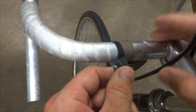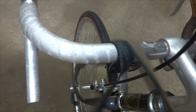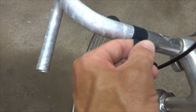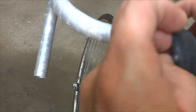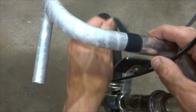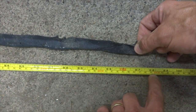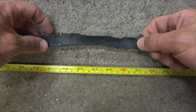I'm almost to the top of the bar now. Wrapping this around to see how they got started — it starts right back here, and it looks like they do about two centimeters worth of overlap before starting to spiral out. Now all the handlebar tape is off. Stretching out the unwrapped tape, it's a little over eight feet or almost two and a half meters long, which should give you an idea of how much tape you'll need to rewrap the handlebars.